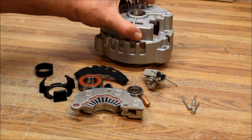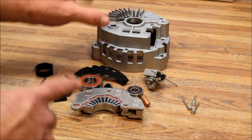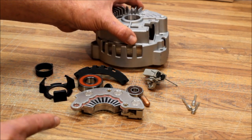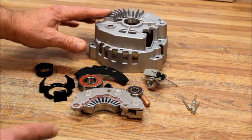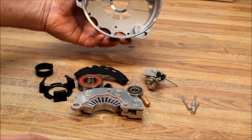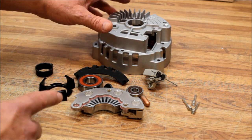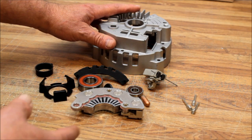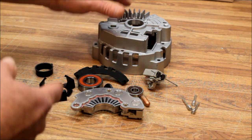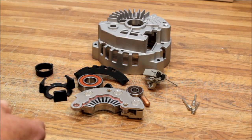This is for the GM CS130 alternator — look in the description below for links to both products. We also sell the complete CS130 alternator with the finned housing; I'll put a link to that in the description as well. This is a very good product. I've had many people call or write over the years telling me they used these on their Corvettes or other vehicles where CS130s would fail all the time, and once they put the Iceberg alt housing on for the cooling, they no longer had any failure problems.